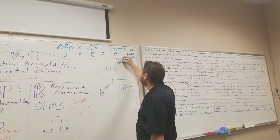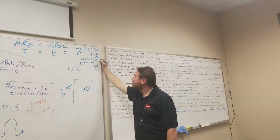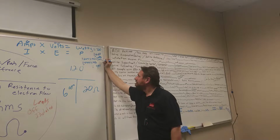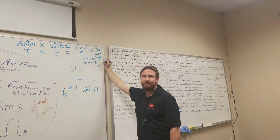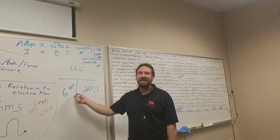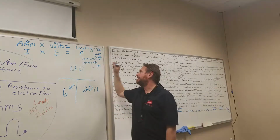My new number is 720, so let's take 720 times 3.413. It's 2,457. So that's about half of my BTUs, which makes sense because before it was 12 amps and now it's 6. So by increasing my resistance, what did it do to my amps? Dropped. Less amps on the same voltage means less watts, and less watts means less heat.